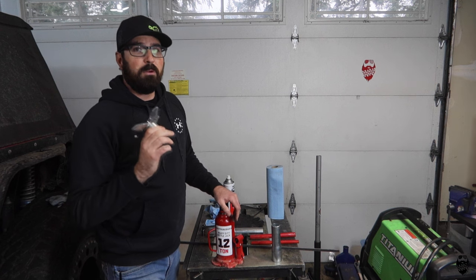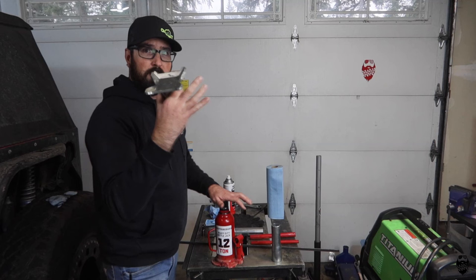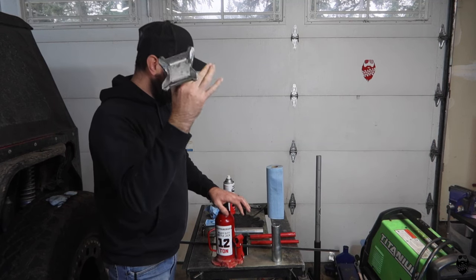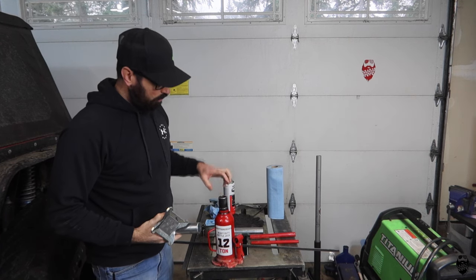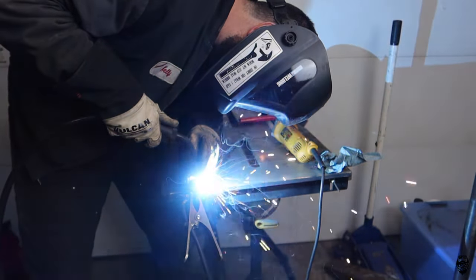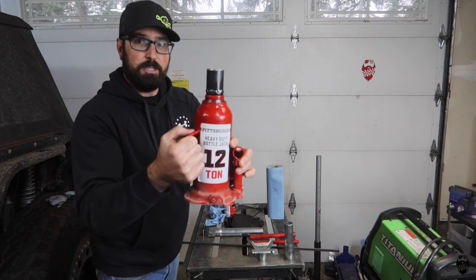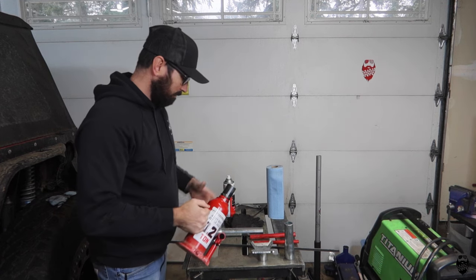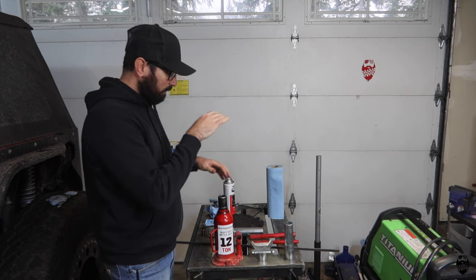Let's take a look at this jack. This kit is from 911 Motorsports. I'll leave a link in the description. It is about $50 and it comes with this jack plate, this extension, and then the tube that welds to the top of the jack. So it's very, very simple. It's just an inch and a half tube that you weld to the top of your jack. That's literally all it is. As long as you have a grinder and a welder, you can install this.